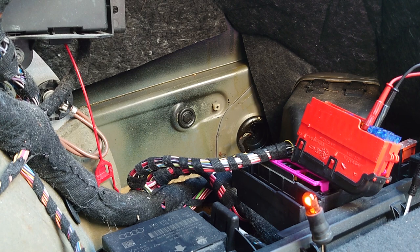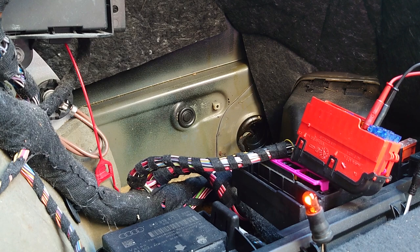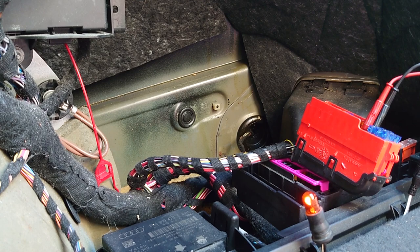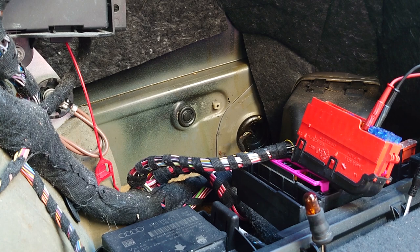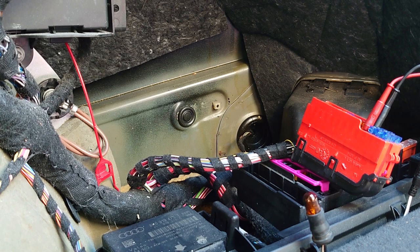What I'm going to do is go to the front of the car and try disconnecting the cigarette lighter to see if the bulb goes out — then we'll know whether we've got a cigarette lighter problem or a wiring problem. With the cigarette lighter disconnected, as you can see the bulb has gone out, so we are going to suspect it is the cigarette lighter and not the wiring.